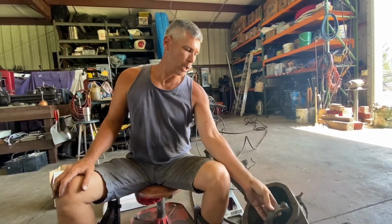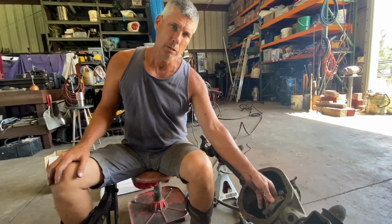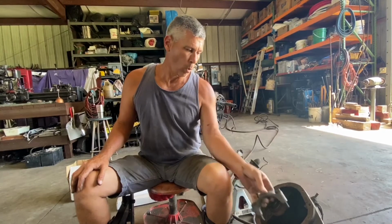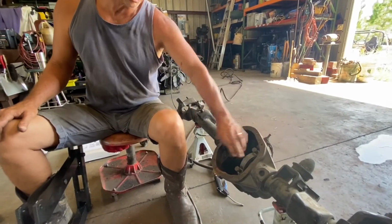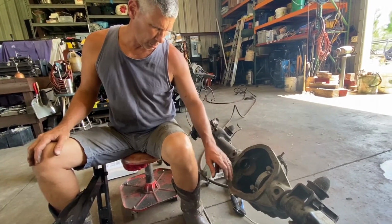Now, if you take a cap off of these differential bearings, make sure that you put it back in the same exact spot. They're usually machined and mated for the proper side. It's not the end of the world, but you can see it from there. So try to keep these oriented and in the place they're supposed to go. Now I've got to clean this housing out, get the gasket surface cleaned off, some rust from where the bearing's been sitting, just a little light surface rust.